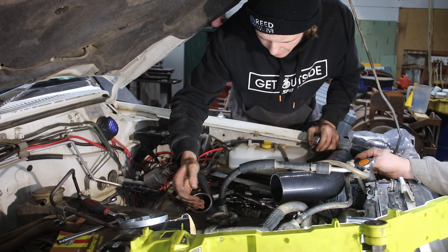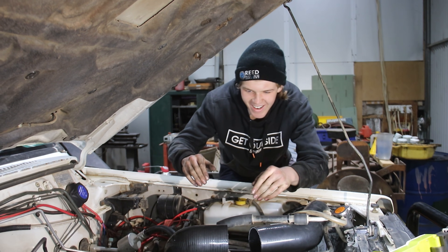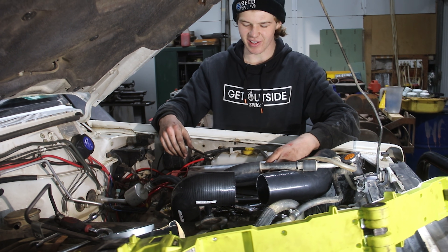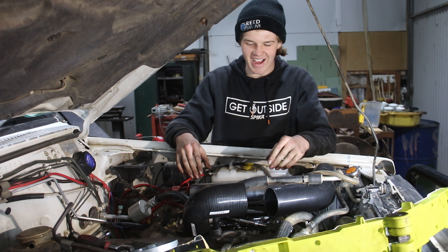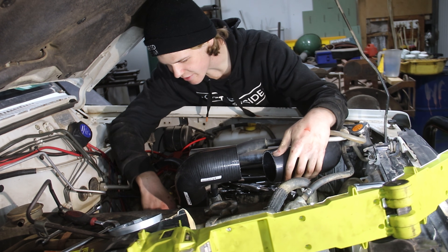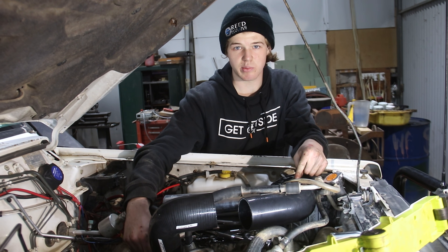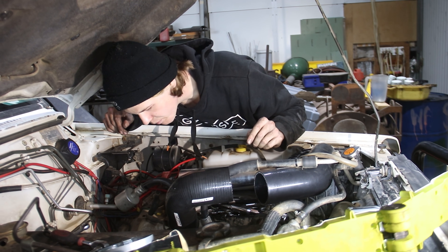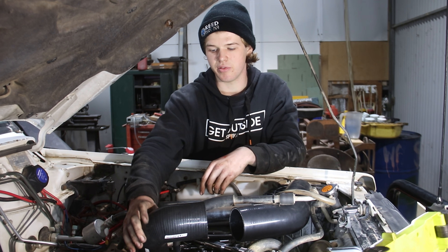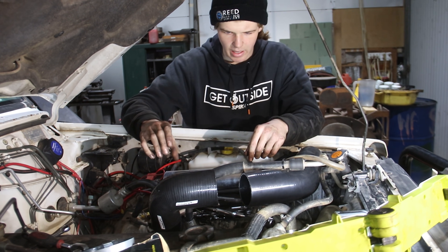I'm so glad that works — I was really worried it wasn't going to line up at all, but it'll work fine. Your car looks aftermarket and modified with those silicone joiners. Looking at the sizing: the intake narrows down so much that it only actually needs to be as big as the inlet on the turbo — and the inlet down at the turbo's smallest point is probably about two inches. So having three inch here and dropping to around 2.75 through the corner and two-and-a-half down there is still plenty of air for a turbo this size.